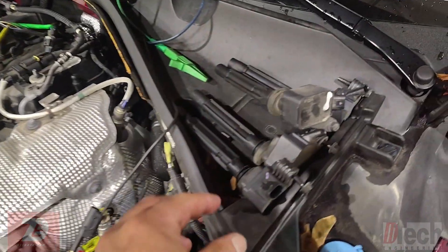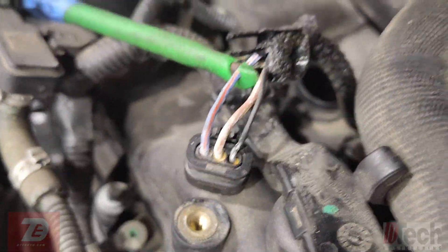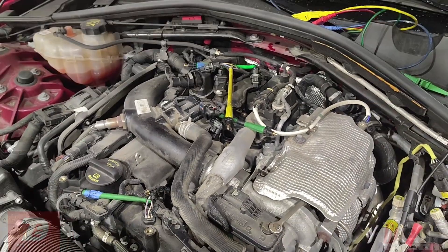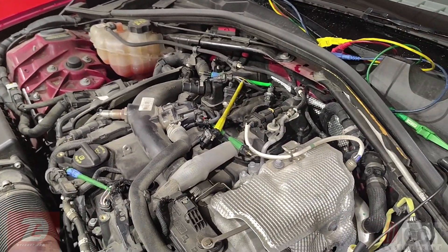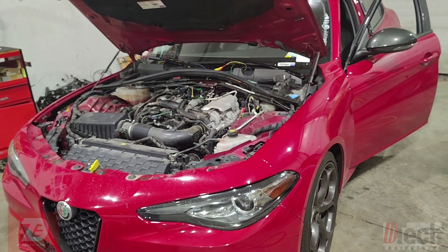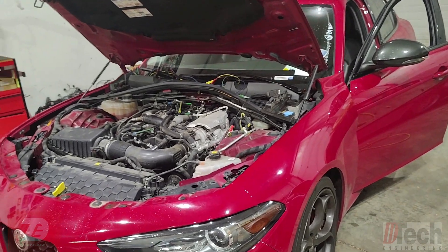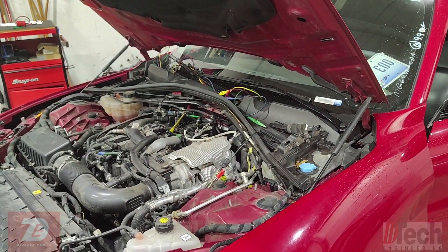These coils basically act as two-wire coils despite the fact that they are physically three-wire. They're kind of like BMW uses three-wires, but they are still dumb coils — not smart coils — which means we can see the ignition primary waveform. Once I realized that, I tapped into all my ignition controls to see my waveforms and went for a test drive. The misfire happens under load; at idle it seems fine, but as soon as you get any load — accelerating — it'll just buck hard, then return to normal once you let off.